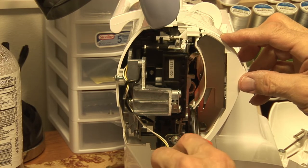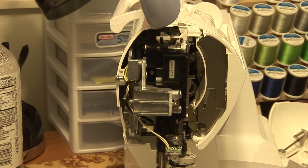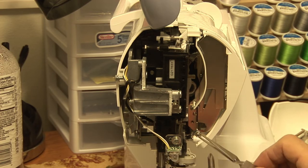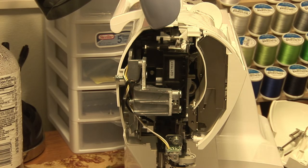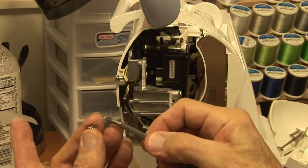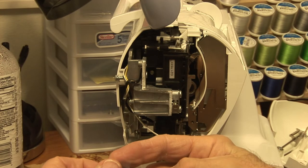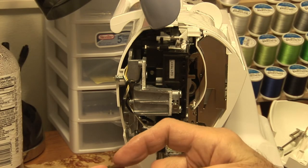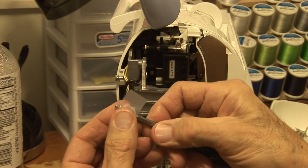The top screw you snug. Okay, you snug it so it stays like that. Now, you could, with the tweezers, put this back. And the other thing you can do, if you want, you know, this is an old mechanics trick, but here's another thing you can do. You could take a small screwdriver to get started with, something maybe this size right here. And then you put your little screw there, right? And you put some tape on it. You don't need much. You just have to put the tape on so that the tape holds the screw like this.